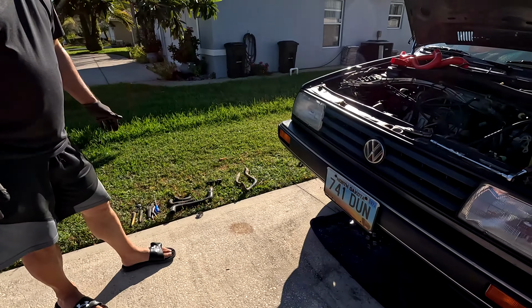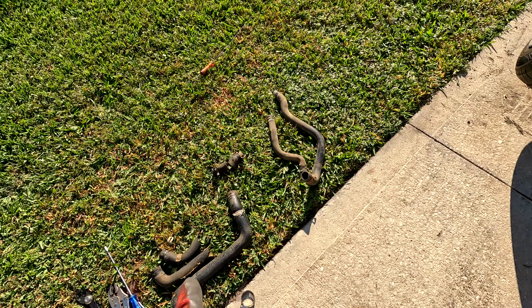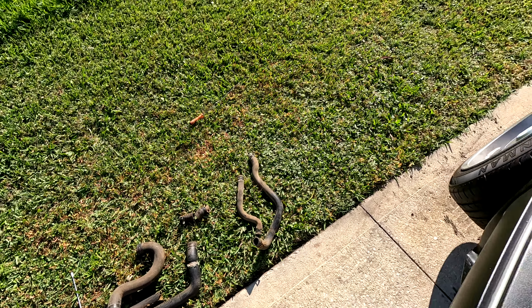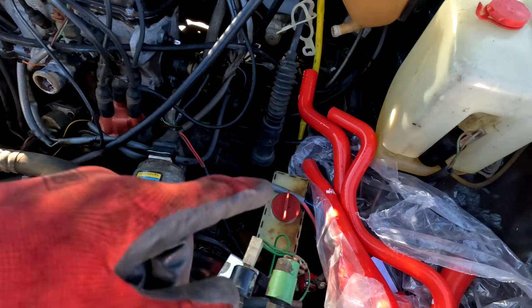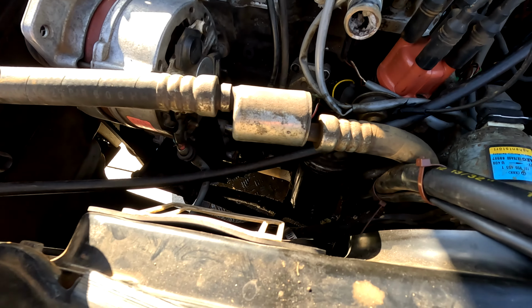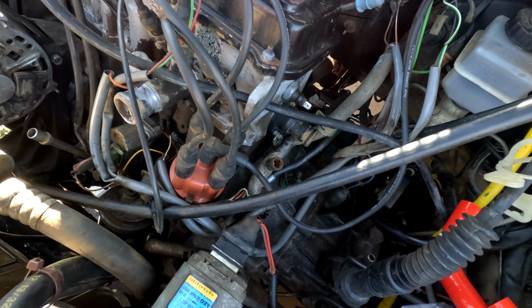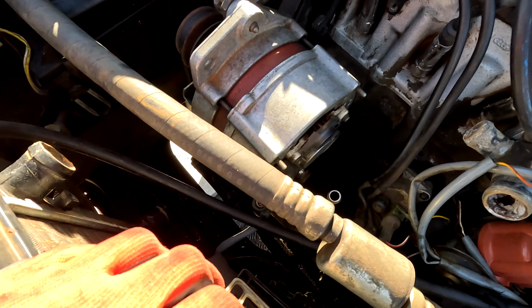All right, well, almost. I got coolant in my mouth. But aside from the taste of coolant, we got the, wherever it went to, somewhere. Oh, it's still in there, actually, yeah. The lower hose is gone, which is an absolute pain to get to, but there's that. So now all seven original ones are out, and now we can go through and toss all the new ones back in, which should be hopefully easier. And then we'll fill it up and check for leaks, and if we're good, we are on our way.